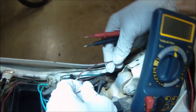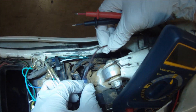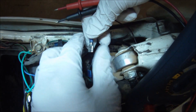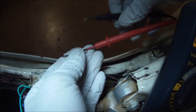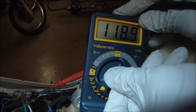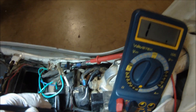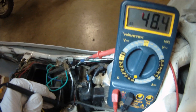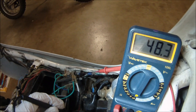It is optional to have the multimeter for this job, but it helps when determining whether the stator may be the cause of your bike not running. To measure the resistance, find the red and black wire coming from the stator and disconnect. Hook the positive end up to the red and black wire and the negative end to a ground. Set the meter to ohms to check the resistance. We have an Electrosport stator in this XR and we should be getting over 100 ohms. The bike was not starting, so this may be an indication that the stator has lost its ability to supply a spark.